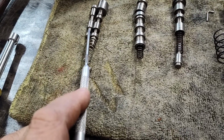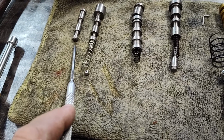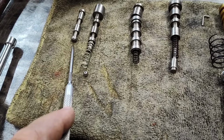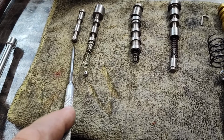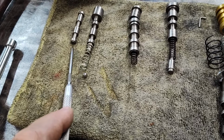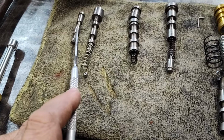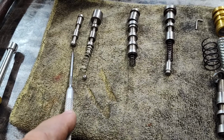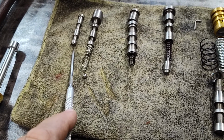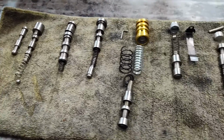And this valve here, it's the cutback valve. Sometimes if it had been modified before, they'll put a spring here or they'll put a ball here. That's fine if it had that. Just go ahead and put it back in. But you don't really need that anymore. Just put the valve back in the bore. Doesn't matter if it's sticking or not. It's not really going to stroke, but it does need to be in there.